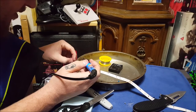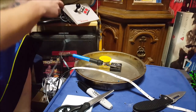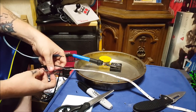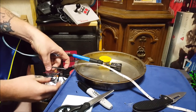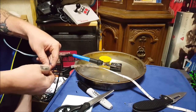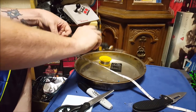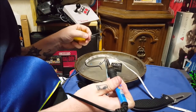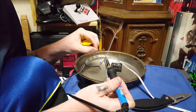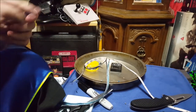This is going to pay off in the end — it's going to look really good. Throw a little tin on there and then just zap it one good time and let your wire sink right into it. Make sure your wires are twisted so there are no strands that are going to touch each other — that one strand can mess you up. Whenever you're splicing two wires together, you can just wrap two wires together like this, but we're actually going to solder them as well to make the bond a lot stronger, and then we'll cover it up.